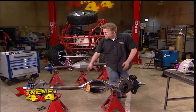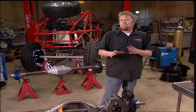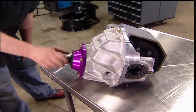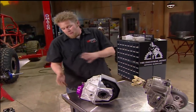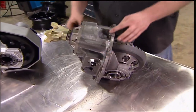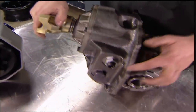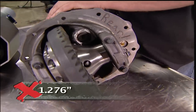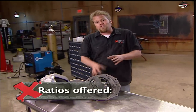Welcome back to Xtreme 4x4, where we've just finished putting together two complete hybrid 609 axle housings. We've used some pretty high-end parts building these, so we don't want to limit ourselves when it comes to the third member. The one downfall to the Ford 9-inch is that the housing was only ever available in a low-pinion carrier option, which means the driveshaft is more susceptible to trail damage and the U-joint is easier to bind when the suspension fully droops out. True High 9 makes a complete replacement carrier for the Ford 9-inch that offers a true 2 and a quarter inches of vertical separation for the pinion, making it a true high-pinion differential. The load bolt on the back of the ring gear and the three-bearing pinion make this one of the strongest gear sets in the aftermarket — we chose the 5.38 gear option. They only sell these completely assembled, so you know the gears are set up right, and you can opt for different lockers or supply your own.